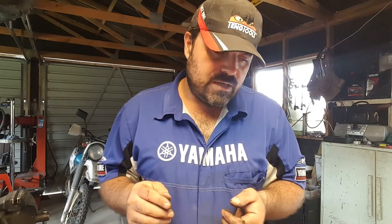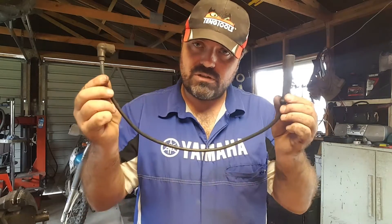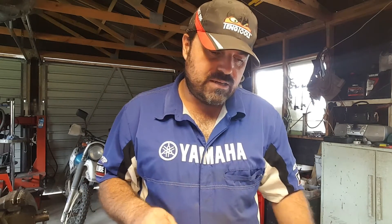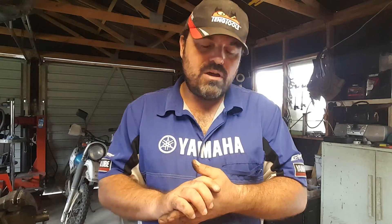I don't have a copper core one here to test. There's also what's called an inductive resistor type, which is what this one is — this is an inductive resistor type HT lead. The spec for that is per metre of length: 2.2 kilo ohms up to 8 kilo ohms. There's also a carbon resistor type, which is 10 kilo ohms to 23 kilo ohms resistance per metre.